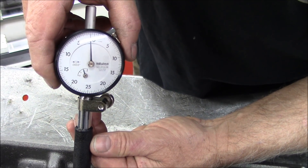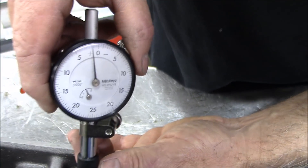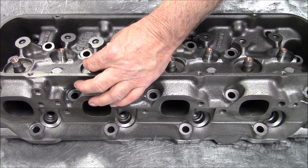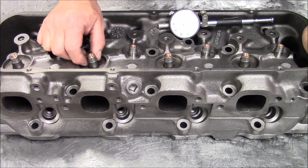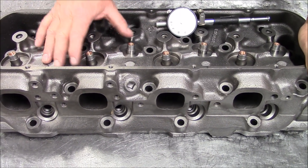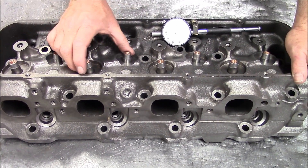We're at about 12 ten-thousandths clearance on the intake guide, and about 15 ten-thousandths on the exhaust guide. If these were a smooth wall K-line, we'd run more clearance, but these are an interrupted spiral so they hold a little bit of oil — you can run these a little tighter. If you can run it tighter and get away with that without it seizing, that's good because you're transferring heat better, and the valve job and everything just lasts longer. So that's the process on honing the valve guides.